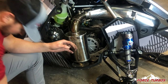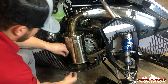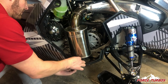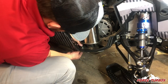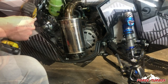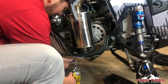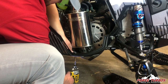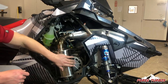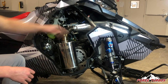Once those are drilled, it's pretty easy. Throw in these bolts with a washer on the top. Don't over-tighten them. You can see the can's not going anywhere — a nice stainless steel look. The can will kind of turn blue and golden brown with the heat over time.